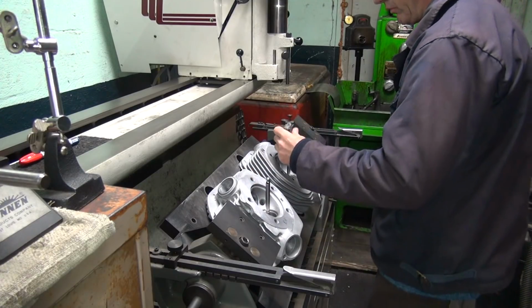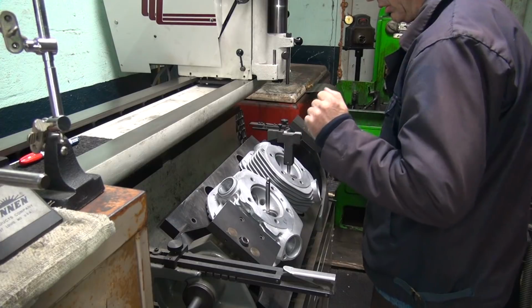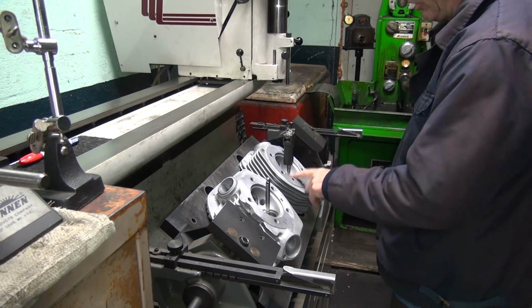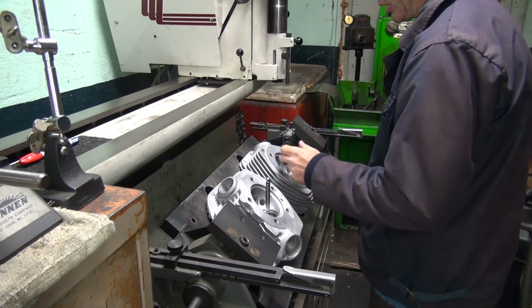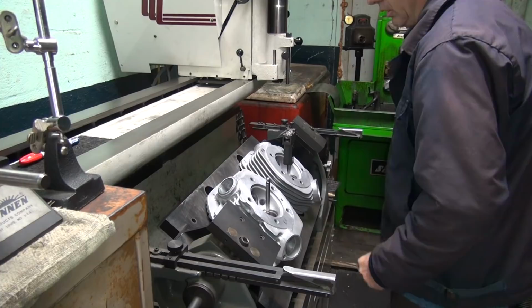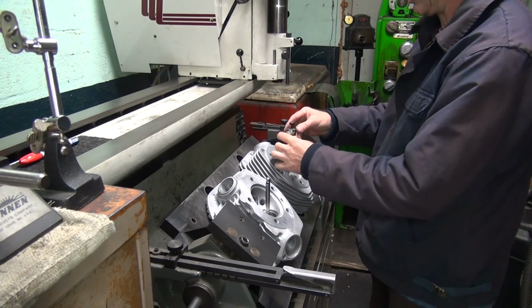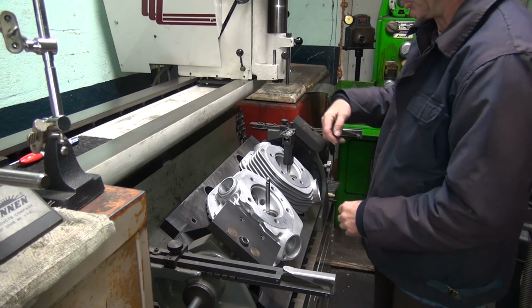For that one. Way the hell off. And way different than that one, yeah. Yeah, these seats are way, everything's way sideways on this set over here. This front head's really bad. Yeah. This guy was way that way. This one here is leaning way toward the push rod right now. I gotta pull it back straight.